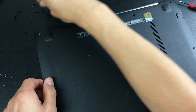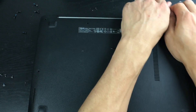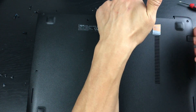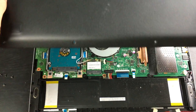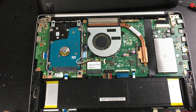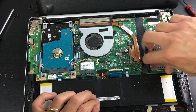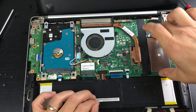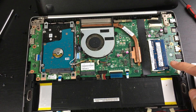This laptop came installed with six gigs of RAM — four gigs onboard and one memory slot with a two gig stick. I'm putting a four gig stick in there, which will bring it from six gigs to eight gigs total. You can see this metal plate here — I just pulled it off with my hands, and that's where the memory hides.